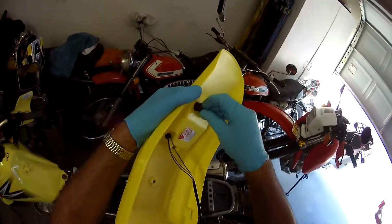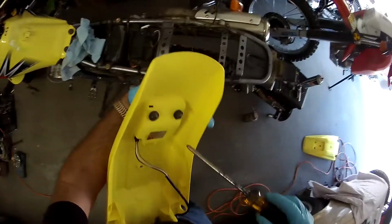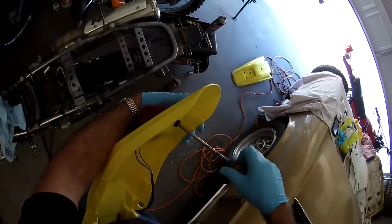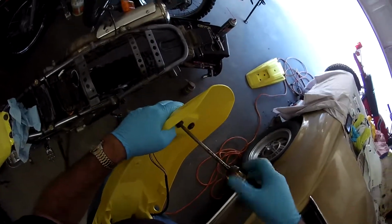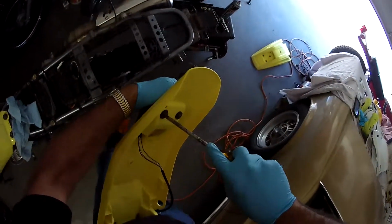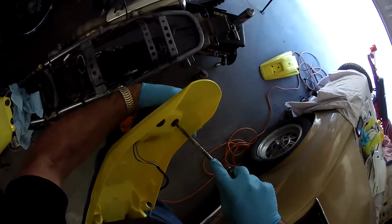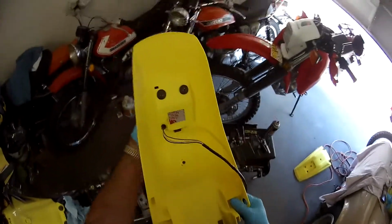It's my day off, and all I've been doing is working on motorcycles. I was finishing up the TS250 over there, the 73 Suzuki TS250. It's one of those days. Some days go great in the shop, some don't. But anyway, I went to start it up, and it wouldn't start. And when I did get it started, it makes this chirping sound because the head gasket is blowing. So I either didn't get it centered when I put the head on or something. I mean, there's only 6 bolts holding it on, but sometimes you go, good Lord, just let it be.